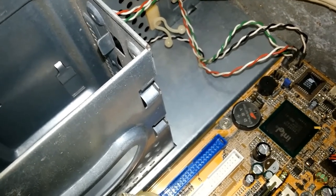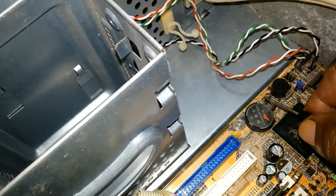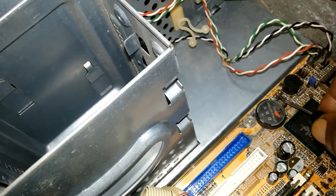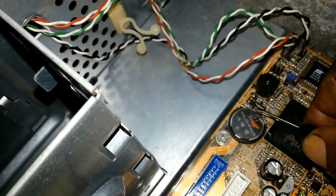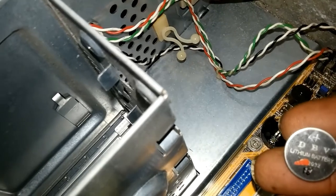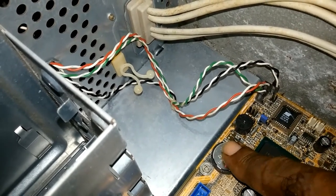That means the battery is seated. To remove the CMOS battery — it's a CMOS battery which holds the time and the date for the computer and any settings you may set in the BIOS — you put your screwdriver on the little lever at the back of the battery and you press it; the battery flies up or pops up. You take your battery and replace it. Remember, the battery is CR2032. You put it in and press slightly.